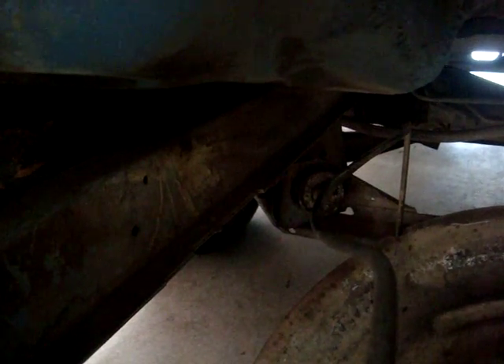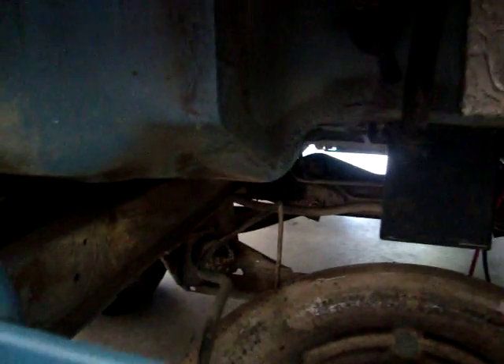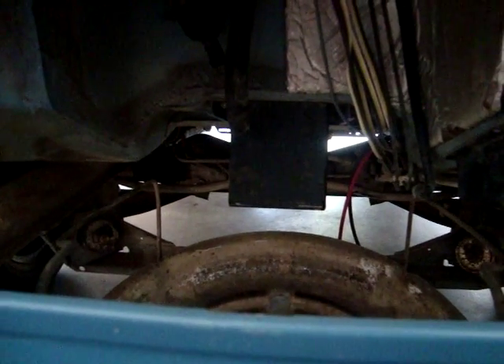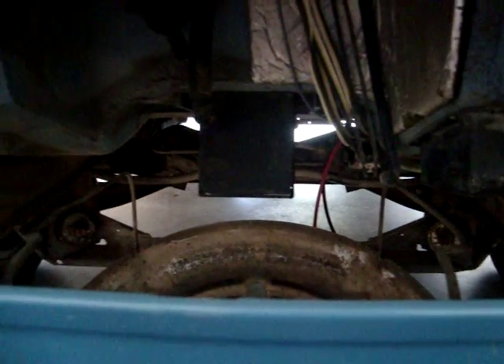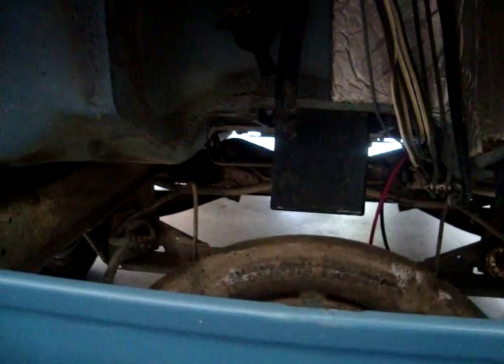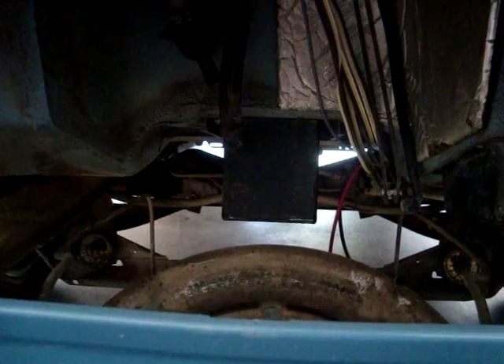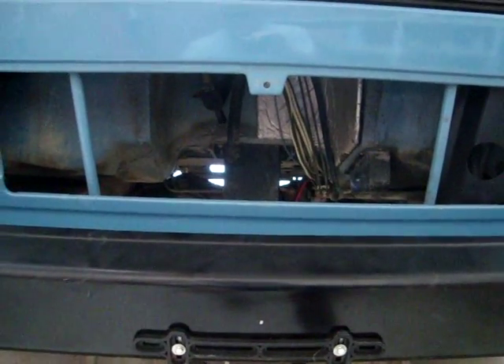We were talking about putting the pump for the heater right here. We want to make sure that it doesn't interfere with the spare tire or cause any problems with somebody replacing a tire and causing an issue with any of the components we are adding. So we're going to do that first, then install our heater components, and take pack voltage forward to the DC to DC converter, the JLD 404, and so forth. That will all come together and wrap up simultaneously, pretty much finishing us up in the front here for component placement and wiring.